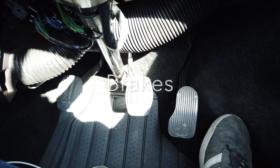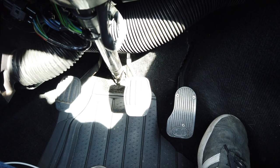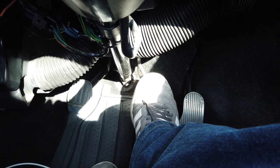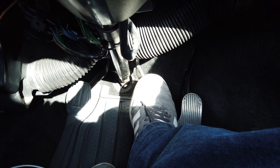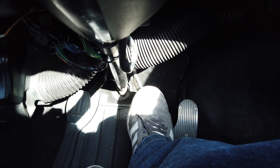Next, while sitting in the driver's seat, I checked the condition and operation of the brake pedal. I pressed the pedal to check that there was no creep and that I got a firm feel. I also checked to ensure the pedal was in good condition with no obvious leaks on the carpet. This test went well and so I assessed a pass.